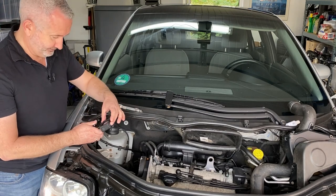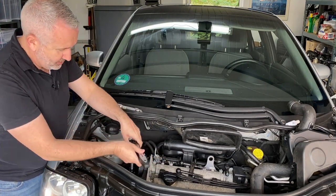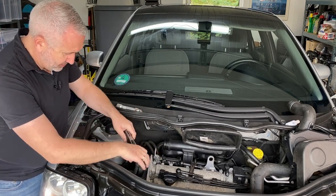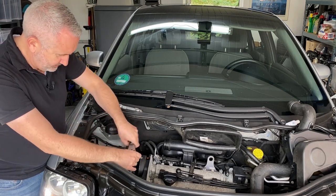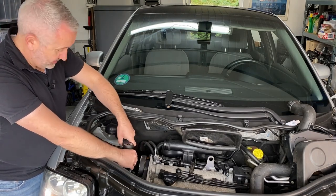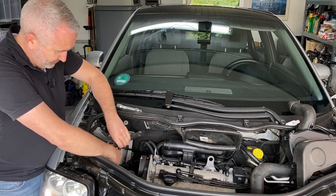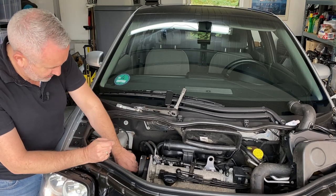This is a rather annoying feature of this engine — the timing belt runs through the engine mount. This thing here is the engine mount. First thing we have to do is remove this part of the engine mount, then we remove this part, and that lets us get access to the various pulleys and tensioners of the timing belt. Here's the second timing belt, the one that joins the cams. All of this has to be removed. Because I'm removing the engine mount, we need to take the weight of the engine — which is why earlier you saw I had my car jack and a piece of wood under the engine sump to hold things up. There are three bolts holding this on.